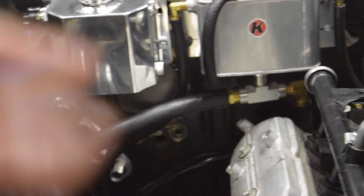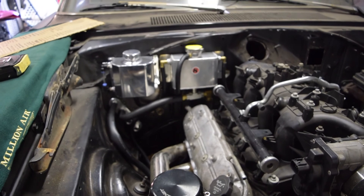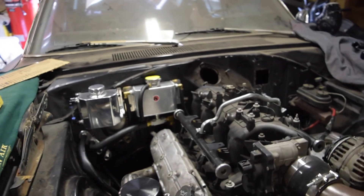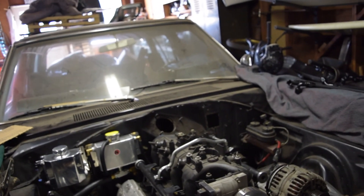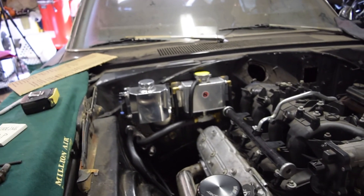All done — I just need to order one more cap for my radiator up here to make sure that never pops, because I want any overflow to happen at the expansion tank and not at the radiator. The last little piece is making some AC lines through those two bottom ports in the firewall. So that's a wrap on the cooling system. I had to spend a lot of time researching this and making sure I'd get it right, so I'm pretty happy with how it turned out. That'll get taken apart when we uninstall the engine for blasting, painting, and coating. Next episode: ignition coil mounting, power steering system, and PCV catch can system. Hit me up in the comments with any questions — thanks for watching!